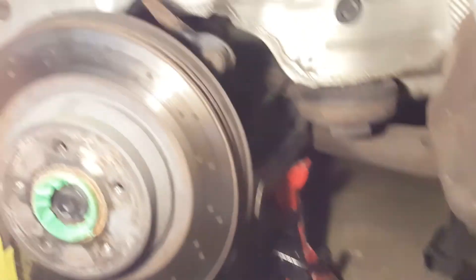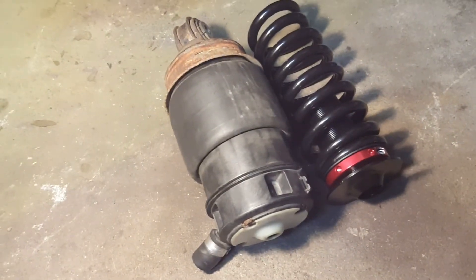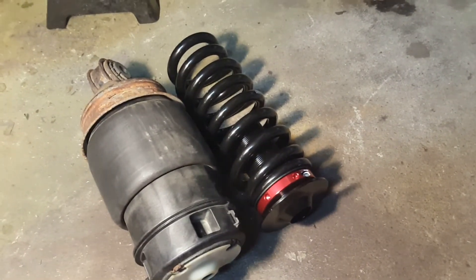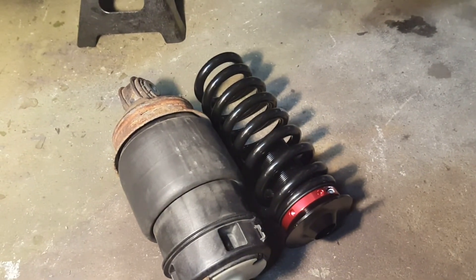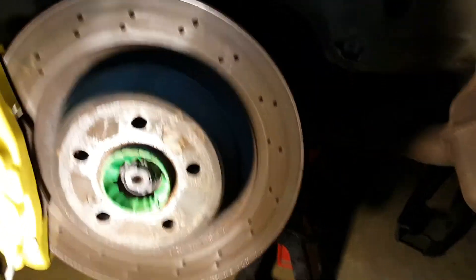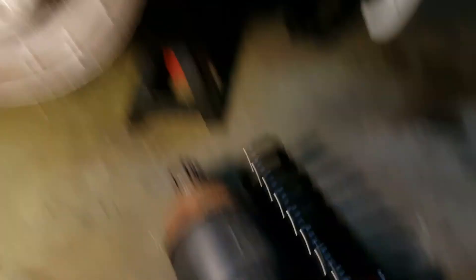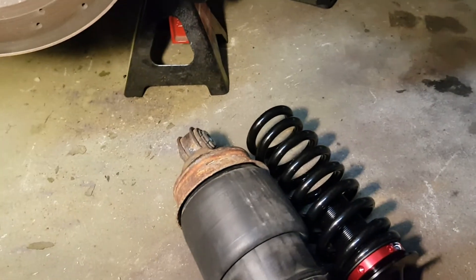After pulling out most of the rear suspension, I realized the coil springs that came with the kit simply won't fit this car. The air spring that originally fits is much larger, and the coil spring from the kit appears to be made for the E500 or E320 — the models that come without air suspension. With the airmatics disconnected and the coil springs incompatible, the car is pretty much stranded right now.